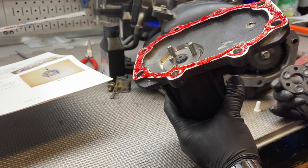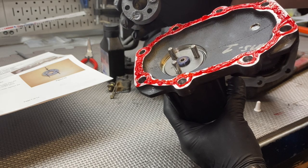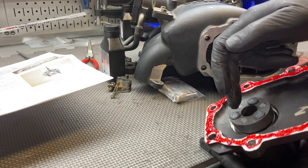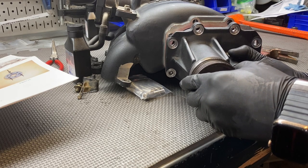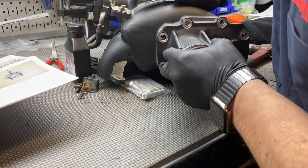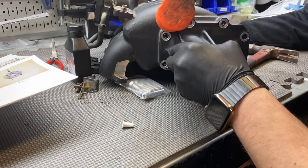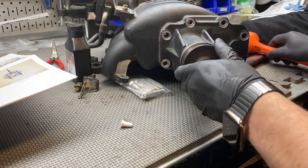Don't forget the phenolic block and coupler. We insert the attachment pins into the holes with the flange openings — those are the openings with grease in them — and press the phenolic block until it seats fully against the gear. Then we install the phenolic block onto the guide pins of the supercharger housing, turning it slightly to guide them in, and press on the nose cone carefully so the dowels fit into their holes without messing up the gasket. Some light persuasion with a mallet gets it seated.